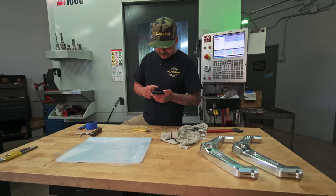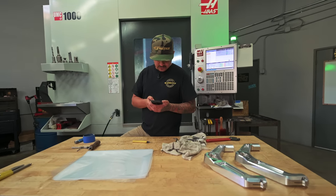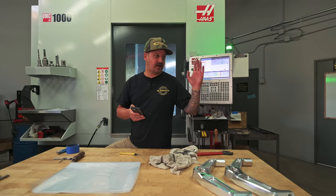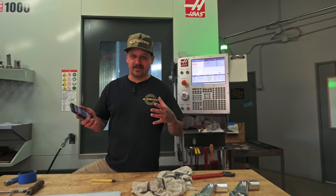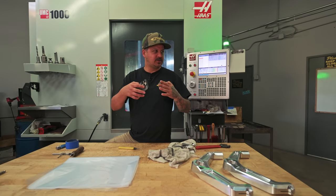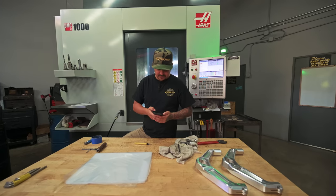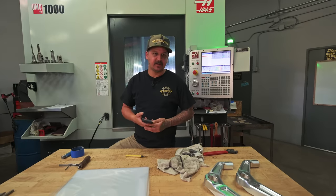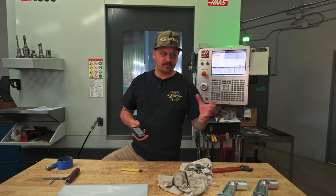How do you decide between bent or mitered junctions when designing your tube structure — is it purely a packaging issue? Pretty much everything you see here uses a lot of miters. We try to do as minimal bends as possible because a bunch of bends everywhere makes the chassis look bubbly and ugly, and it doesn't give you a clean corner junction to land your tubes. Every junction has a miter and a bunch of tubes land in that sharp point. For paneling, if you use miters all your panels have a natural home based off the tube layout. Also for laser-cut tubes — if it's a miter joint it's done, no bending post-process.